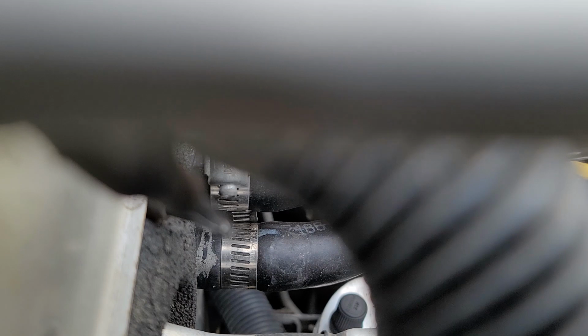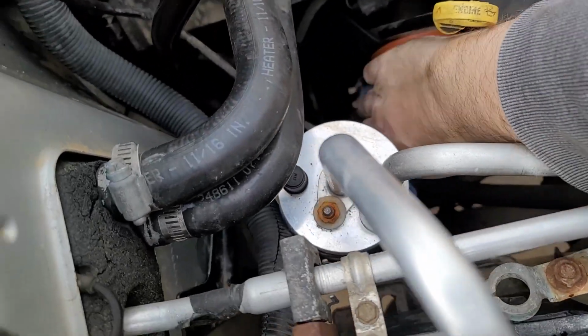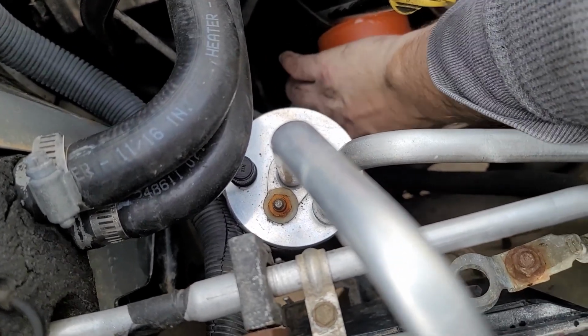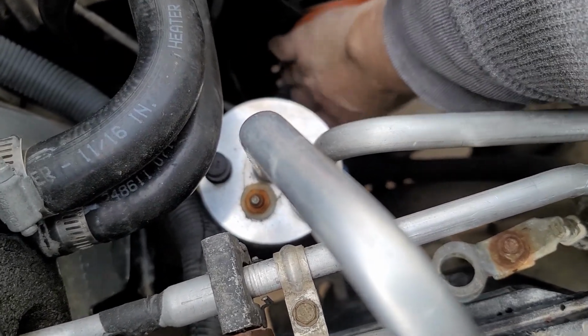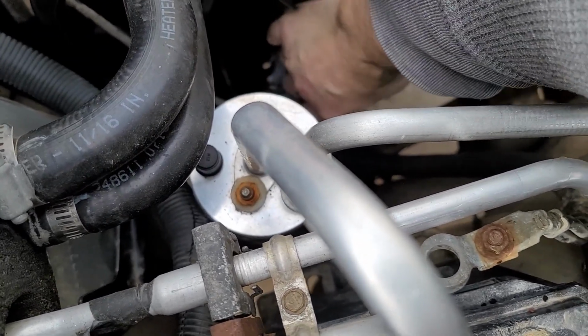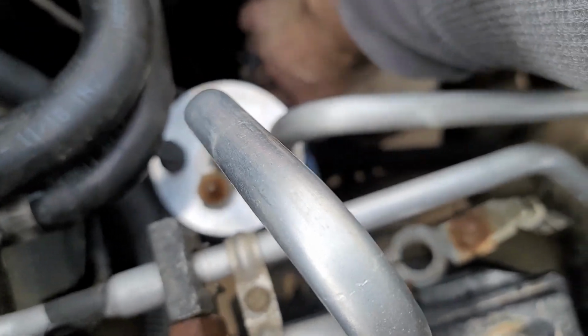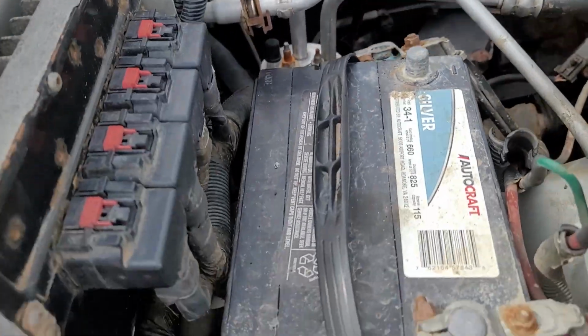And you're gonna want dry hands. But just finger tight, hand tight. Not oil filter tight or oil filter wrench tight. Not as strong as you can possibly turn it. Snug it in. That's it. It's on there. It's tight.